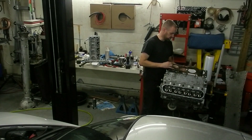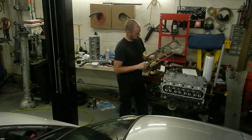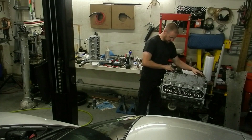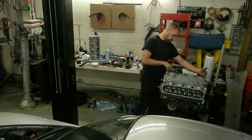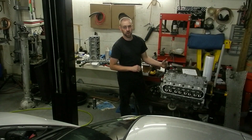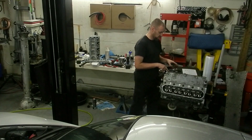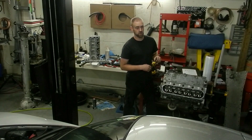One little note I want to make here is head gaskets. There is a front and a rear — it doesn't say rear on the rear, but it says front here. The reason for front is because of the cooling system. If you put a head gasket on backwards you will most likely have overheating concerns. See these two openings? Those go towards the back, and the reason for that is pretty simple — it's so that when the antifreeze gets pushed in, it pushes across the cylinders and comes all the way to the end. The majority of it goes all the way to the back and then comes across the head this way, so it can cool it to the maximum. If you just had it come straight up here, these back couple of cylinders won't hardly have any cooling flow, and if you don't have the coolant flow going through them, they're going to get hot. It's to make sure the coolant comes across all the cylinders and combustion chambers to properly cool the engine.